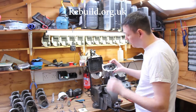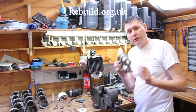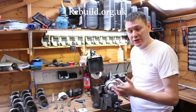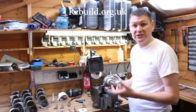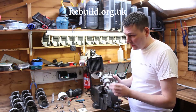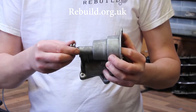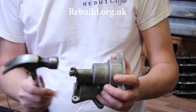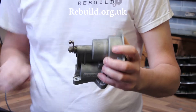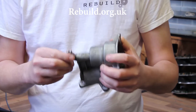A lot of people don't get the pin all the way in. Last of all, check you've got some play — that play is quite important. You want about half a mil. If it's too tight, the engine gets hot, metal expands, and the half gear will just seize up while you're driving. If there's no play after fitting, you can fix this by tapping the back of the nut. Minimum half a mil, maximum two — but anywhere between half and one mil is what you're looking for.